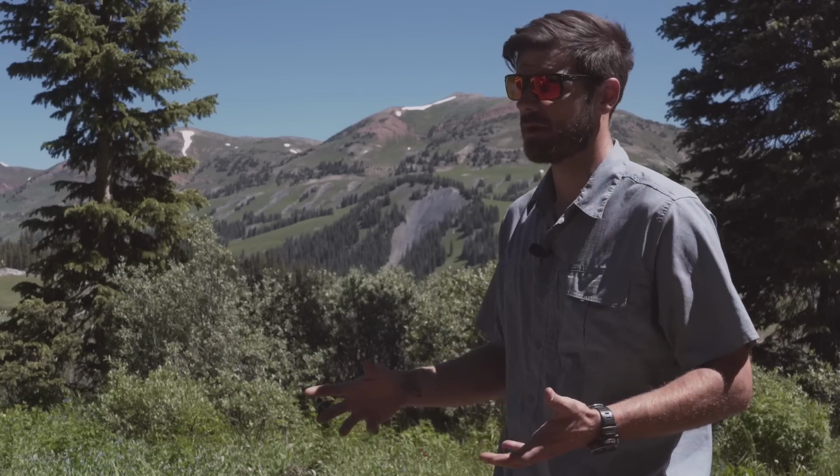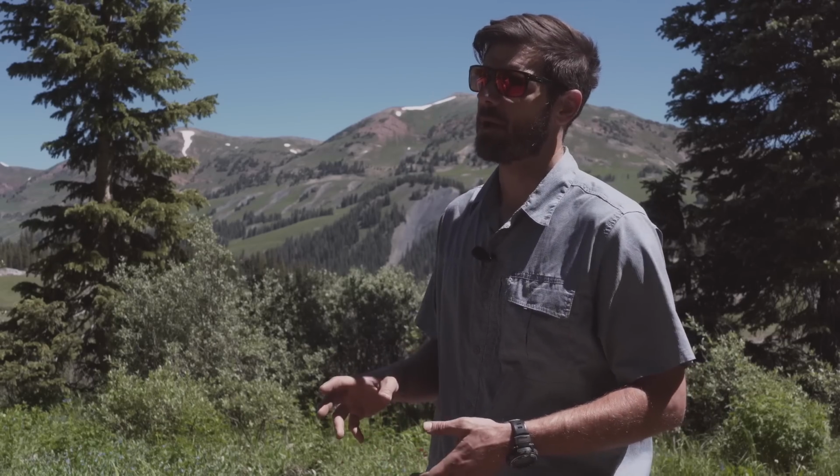And also I was packing a bunch of stuff into the fridge that was warm, typical. On a little setup like this, a little SUV, a little 4Runner, I think that the 50 amp hour is going to suit most people. If I had a Tacoma or some sort of a truck or a camper type topper for a truck, I think I would go with a 100 amp hour battery just so you can worry about it that much less.